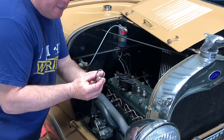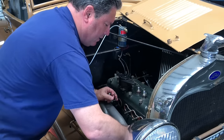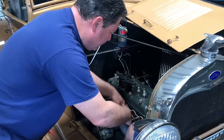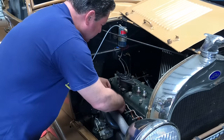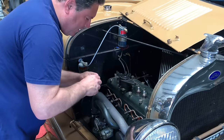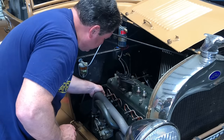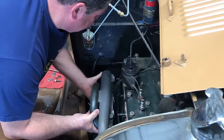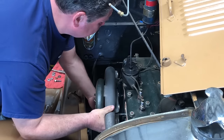Now's the time to insert the gland rings. I like the ones with the little slot on them, so they put a little bit of pressure against the manifold. I install them so that the slot is kind of towards center so that I can see if there's an exhaust leak there. Just slide them into the recesses in the manifold. I pulled the stud out that has the nut stuck onto it, and we're going to go ahead and put this manifold in place. We're going to be very careful here to make sure that we don't mess this up.